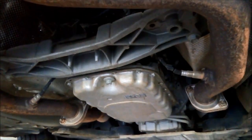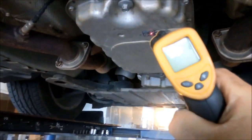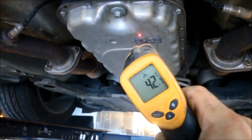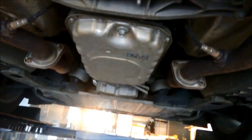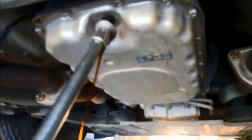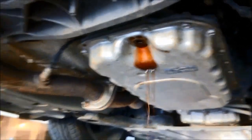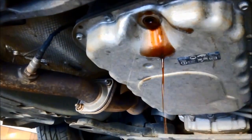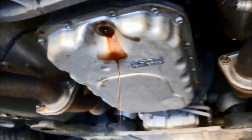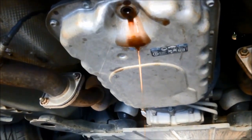Got it started. We're on 31-32 degrees, so I'm just going to take this plug out and check the oil level. You can see we've got enough oil in there — there's probably even a little bit too much, maybe half a litre over, but not enough to cause trouble. What can happen if the oil level is too high and it hits the spinning parts is it can aerate the oil and you get spongy shifts, because air in a hydraulic system can be compressed but oil can't. That looks like it's at the right oil level — it's still trickling out quite quickly.